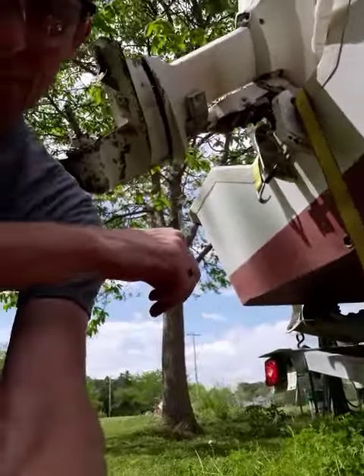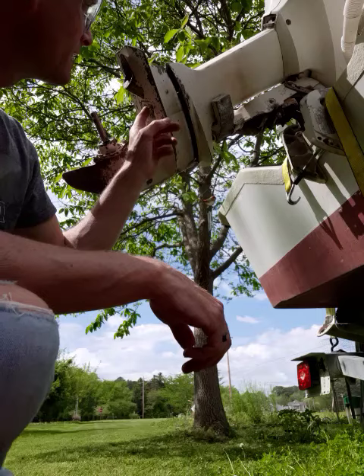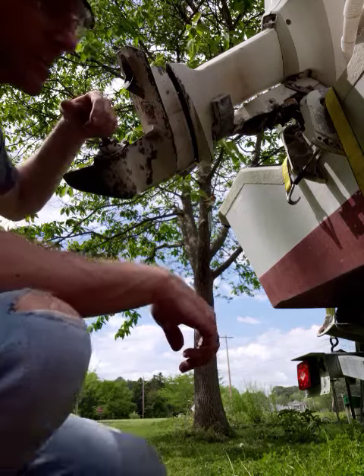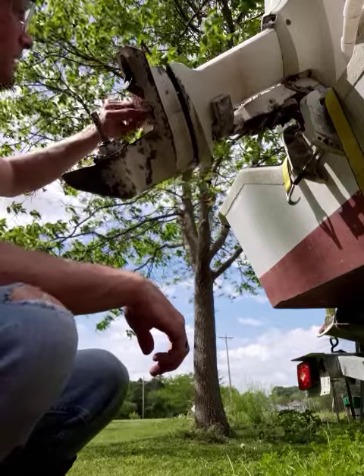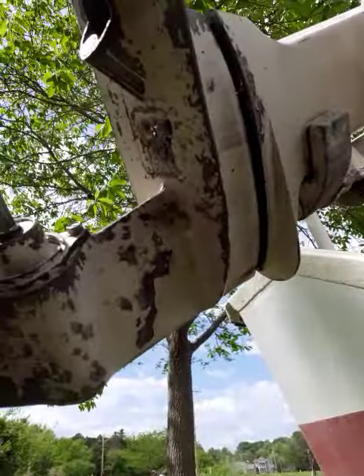Back with my 2003 6 horsepower Johnson. Took me forever to get this bolt free. Finally broke it loose — a few people online recommended heat shocking it: heating it and then cooling it off with hose water. I've hit it with a hammer and cut a groove into the head so I can get a screwdriver straight into it. Got a bolt extractor finally.